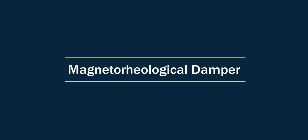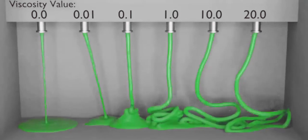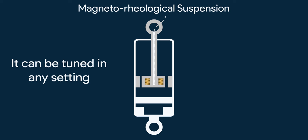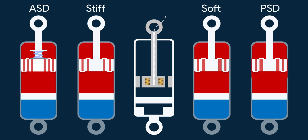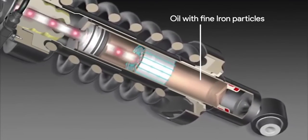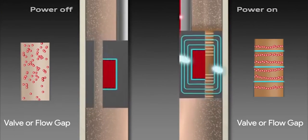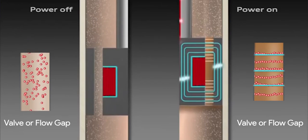Lastly, let's talk about magnetorheological dampers. Rheology means viscosity. In a magnetorheological damper, the viscosity of the oil is adjusted so that the flow resistance can be adjusted to tune the suspension in real time. In magnetorheological suspension, the suspension can be tuned to any setting you want in real time — it can be stiff or soft, acceleration sensitive or position sensitive, and it can also have many zones in a position sensitive setting. So it can be everything you want. The magnetorheological fluid is basically an oil with fine iron particles. By applying magnetism, the iron particles bond with each other, increasing the viscosity. The more the magnetic force you apply, the more viscous the fluid gets, so the fluid flow through the piston valves can be as simple as water or as difficult as ketchup or peanut butter.